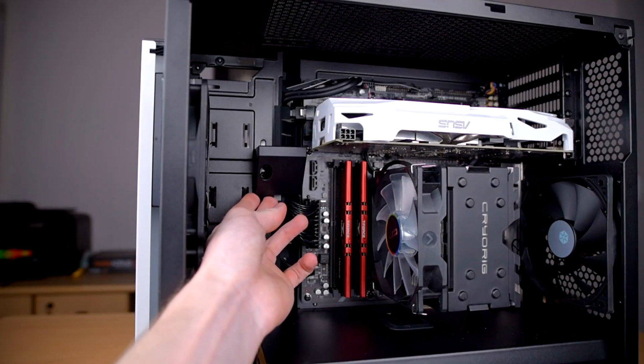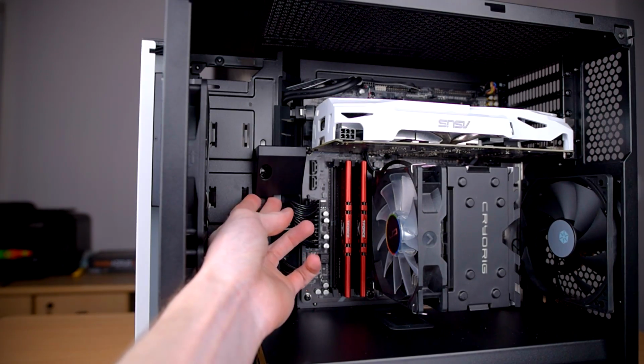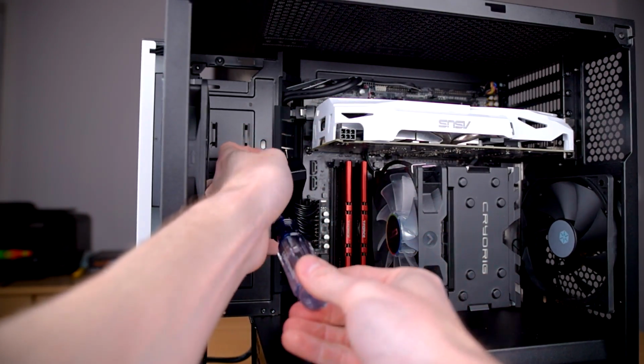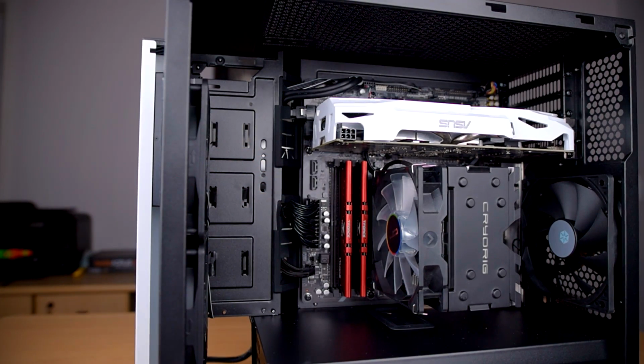Mounted at the front is an adjustable GPU support bracket to prevent sagging with longer GPUs, but it only helps if your graphics card actually reaches past the front edge of the motherboard. Power supplies up to 160 millimeters will fit with the hard drive cage in the farthest back position, or up to 220 millimeters with the cage moved all the way to the front.